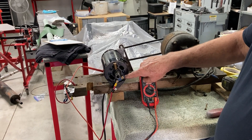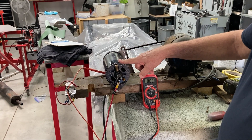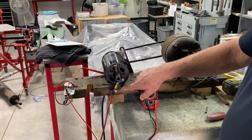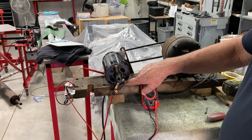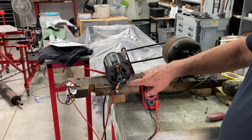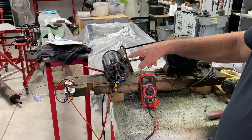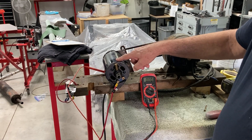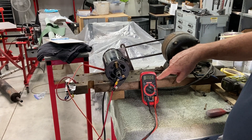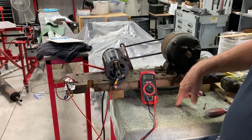We have to be careful that we don't fry the generator with too much output. On the car at idle it's nominal, so you're going to be down in the 8, 9, 12 volt range. But if you rev your car, you can see the reading go up — just be careful about going too high. We've got a fixed rotation on this, so it is on the high side, so it'll be only momentary where you can actually see that output voltage.